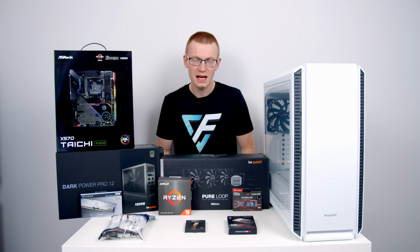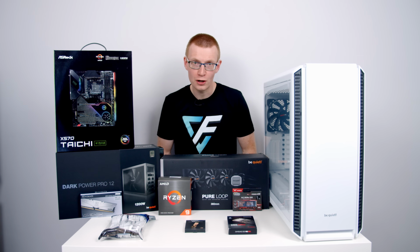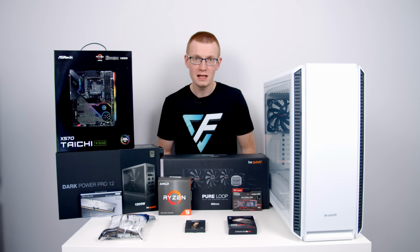So again, when deciding which GPU to go for a video editing PC, it's going to be determined by your budget, but also your workflow. And it is important to decide what package you're going to be using beforehand, because some packages don't really use the GPU. DaVinci Resolve does, and if you go for the studio version, it's going to rely heavier on your GPU than the free version. Another important thing to keep in mind is you may want to use your PC for more than one purpose.